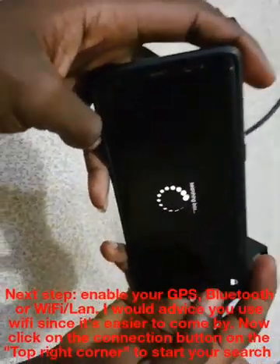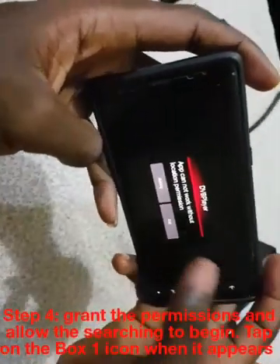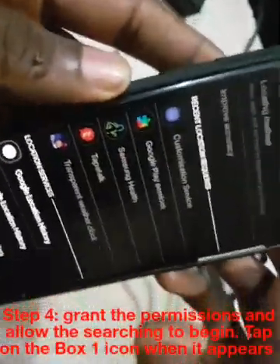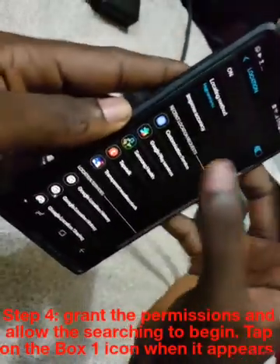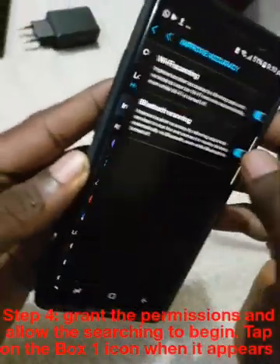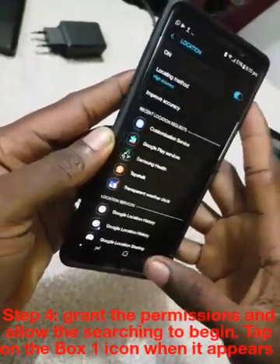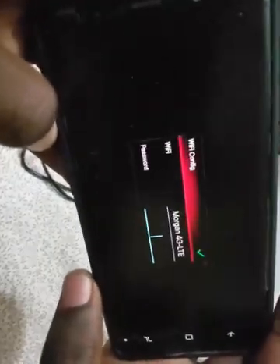The following are the basic steps to do this. First, connect your satellite dish antenna's coaxial cable to the LNB in port on Helibox Smart S2. Secondly, connect the USB end of the micro USB cable to your power source and the other end to the Helibox Smart S2 device. Immediately, the blue and red LED on Helibox will start flashing.